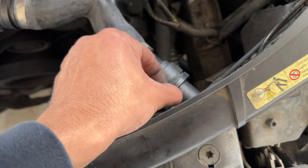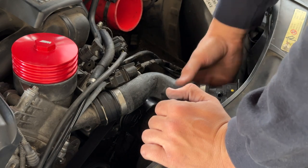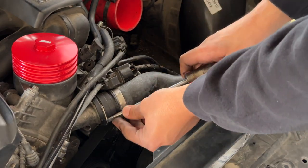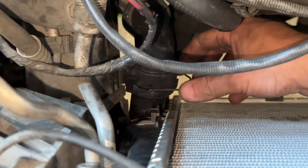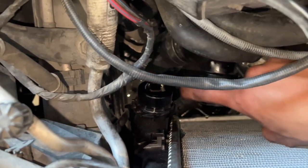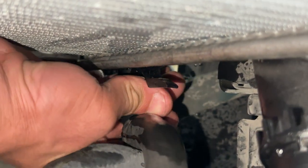With the fan clutch removed, remove the upper radiator hose — pull off the clip, pop it to the side, and that frees up the upper hose. Pull it down, then grab the main hose and pull it clean off. We're replacing this hose anyway. Then remove the two coolant hoses holding themselves to the radiator at the bottom. Pop the clips, grab and pull the hoses off — use a drip pan underneath. One clip is at a terrible angle; best to use a little hook tool. Be aware more coolant will come out when you remove these.